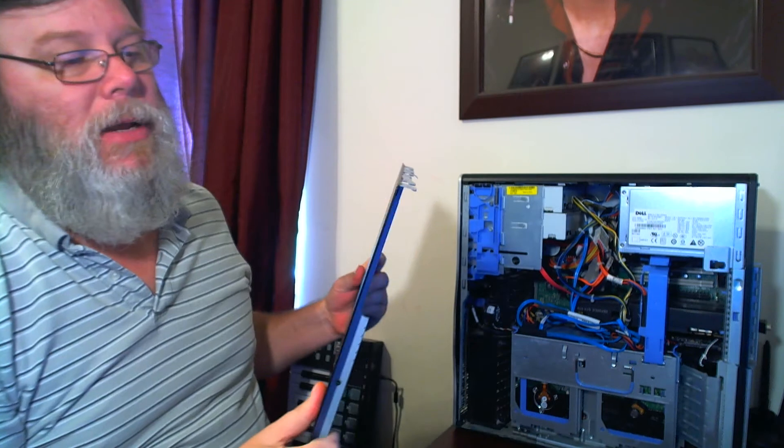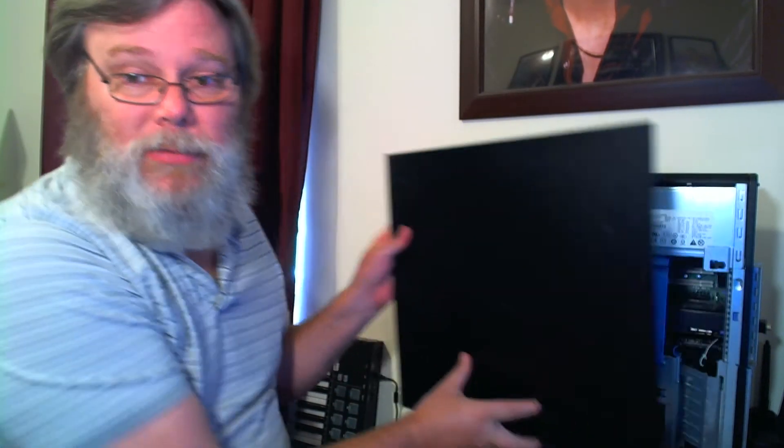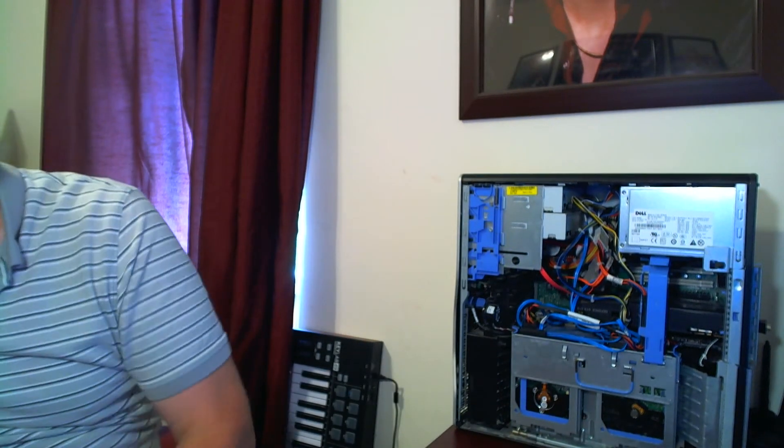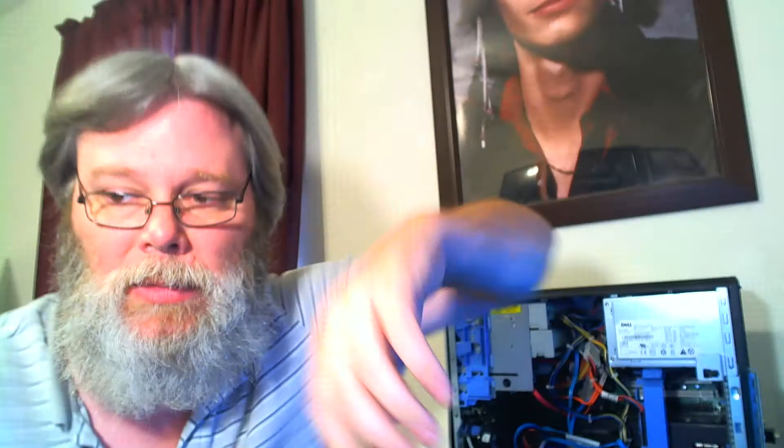Now, see how I took that door off? It doesn't always shut all the way on the back. This is your system intrusion button — just a little button here. What happens is, if the cover doesn't latch properly, the system thinks the cover is off. If it thinks the cover's off, it thinks it can't get proper airflow because it's wide open, so it revs the fans up.